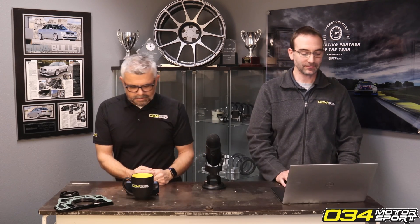The problem is finding someone who can do a coating that lasts on the inside — you don't want to feed your turbine a bunch of coating flakes, or have it just come off and be a complete waste of money. We used to do a lot more custom turbo systems, so I had companies I'd send stuff out to. Jet Hot was good — we used to use them. But there were lots of bad ones too, including a couple local ones here in California where you'd take the header out a month later and the coating was just gone.